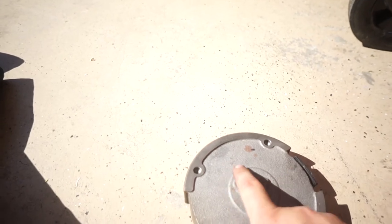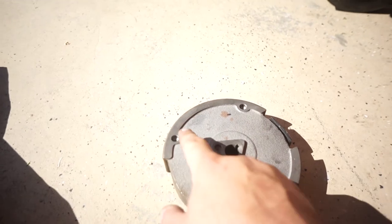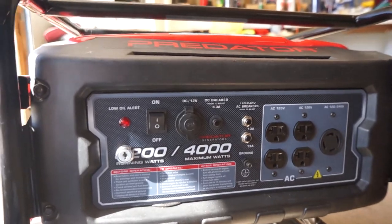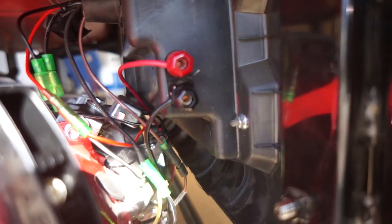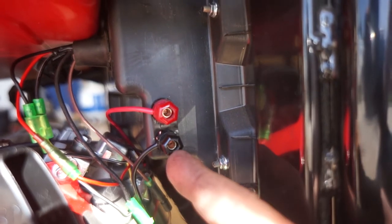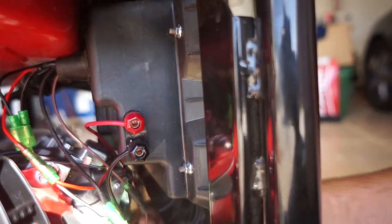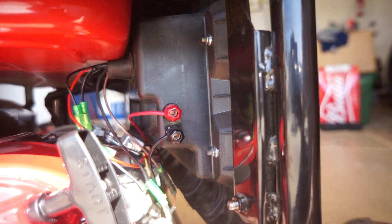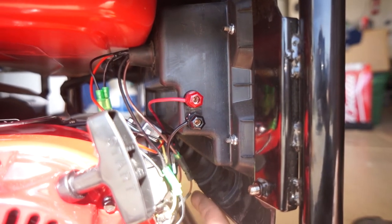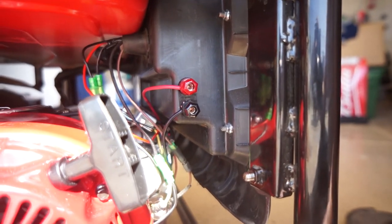This does only go on one way. The new one doesn't have the triangle but it does go where these two are pointing at each other and you'll see where that goes. I did add the switch — this also does the cranking portion of it, which a lot of people use for testing on external items. This right here is what I use for the power and ground going down to the starter, looped inside on the back for the positive for the starter switch. The only two wires I use from the starter switch: one is for the solenoid for the starter and the other one is this brown one here which is for the charge portion inside.